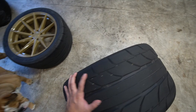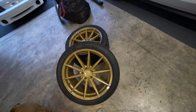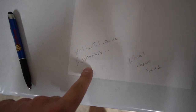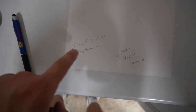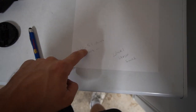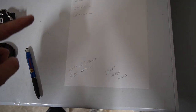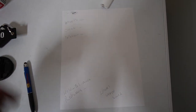Not too bad — both Rohanas weigh 63 pounds each. Let's do some math: both Rohanas at 63.4 each equals 126 pounds, minus 102 for both Welds. We saved a total of 24 pounds just in wheels alone. I'm going to write that down, then we're going to take out the seat and speaker and add them all up to see what we officially get.